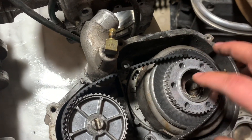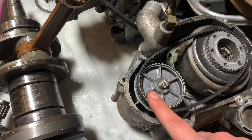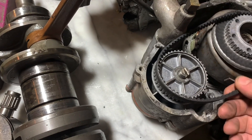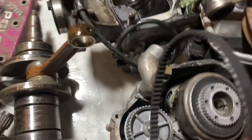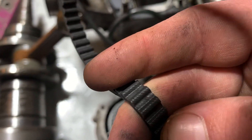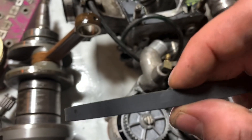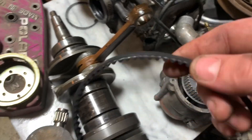So it spins the magneto, turns this gear, turns the belt, turns the coolant and oil pumps. This belt is very important — it's good to check the condition of them. I like to bend it backwards to make sure it's not worn out or frayed. There's also a width measurement, though I don't remember that off the top of my head.